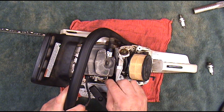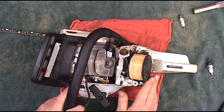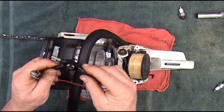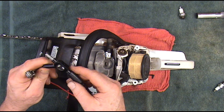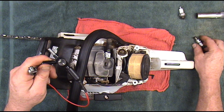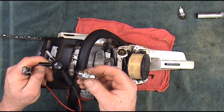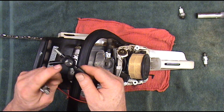Then you can test it again plugged in with the switch on and off if you want, just to make sure that's working correctly. What I like to use is a spark checker here with a gap that is almost a quarter inch. This coil needs to be able to jump that gap when you're testing it in order to fire this plug under compression. With that small gap it takes a lot more force to fire that plug under compression, so when we're testing it we want to jump almost a quarter inch.